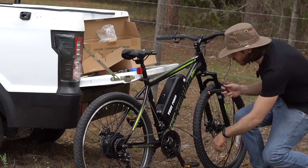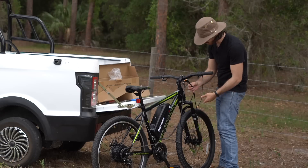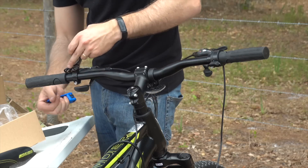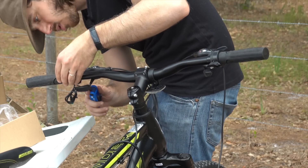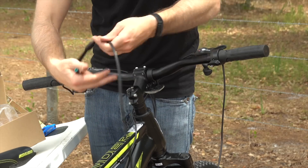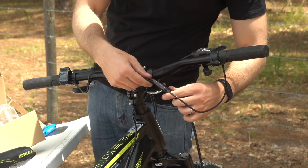This wiring bundle is going to plug in down at the controller. Everything is color-coded — green is the display, yellow is the throttle. The bundle runs up to the handlebars to plug in all the different accessories. We're not going to use those brake inhibitors, so two connectors will be left unused. We've got a little display here — just wiggle the grip out a little, bolt the display on the inside of the grip. I would have loved to see them include plastic covers for unused connectors, but you can cover them with electrical tape. They give you a pile of cable ties to run wires and make them look nice.